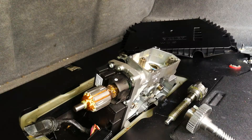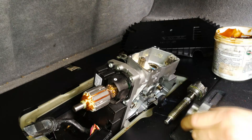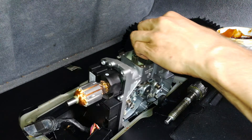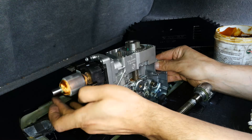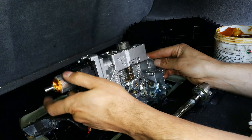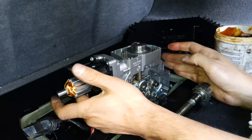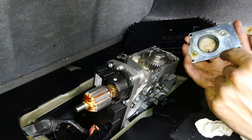Now there's the new one. I've got some lithium grease here — this is high-temperature bearing grease, good for metal on metal. Now I'm seating it in by rotating the armature, and by rotating the armature it is slowly going in there.